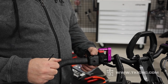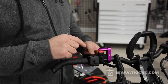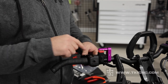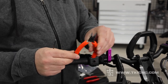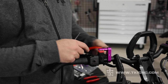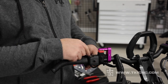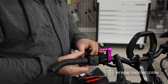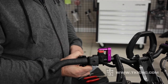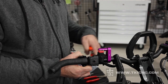So now that we have the screws that hold the flipper to the throttle block removed, we need to remove the cable from the flipper. I did forget to mention you will need small pliers that you can use when we pull the cable out. We'll hold on to it so we can get the little barbell out of the plastic. What we're going to do is pull the flipper and then hold on to the cable so it doesn't retract.